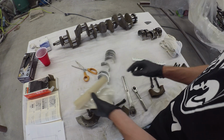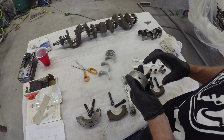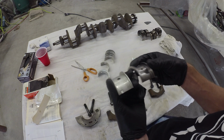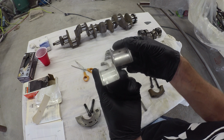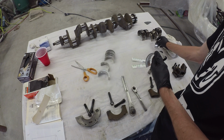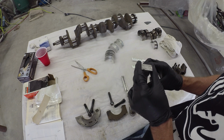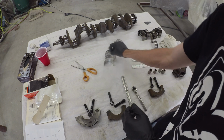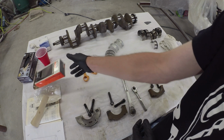Alrighty, so nipped the pack out of the Repco. Interestingly enough, it does have the same markings as the Clevites, pretty much the exact same stamping, so they're different than the OEM. But oddly enough, the Repcos are standards, but they're 1123Bs versus 1123s for this particular one. This is the thrust bearing. I don't know if any of the other ones have a different. Yeah, so these are all 1123Bs, which is interesting. The part number is still standard, so we'll see what they do.